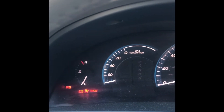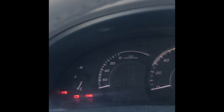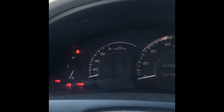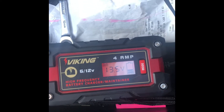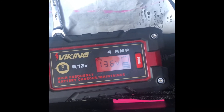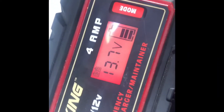The car tries to start — you can hear it rattling. The battery will be fixed temporarily. The voltage is only about 11.3 volts. I have it on the charger. I thought it was an AGM battery, but checking the label, it actually says it's a 12-volt standard battery.